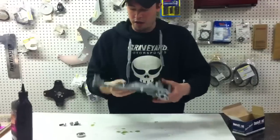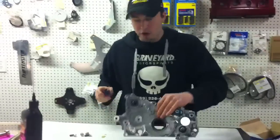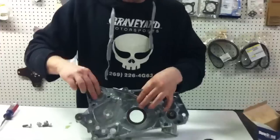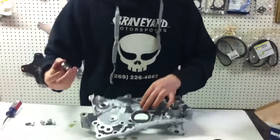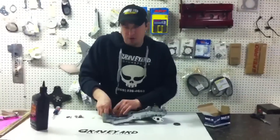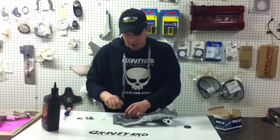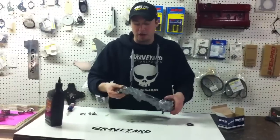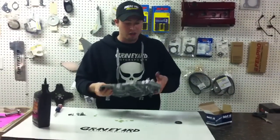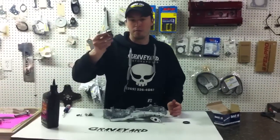The very last step is the plug. When your oil pump comes in, there'll be an oil seal here that you remove and then insert the plug. We like to use a two-part epoxy to set it in place. It'll press in slightly — if you do it too harshly you risk cracking the housing. I usually use a hammer and just lightly tap it in with the epoxy. That should hold and keep oil from coming out of the hole. Once the plug is secure and you let it dry, your oil pump is finished and you can work on the block by putting in the block-off variants.